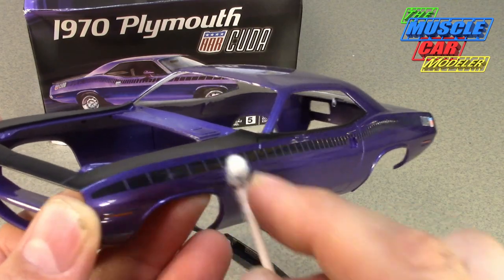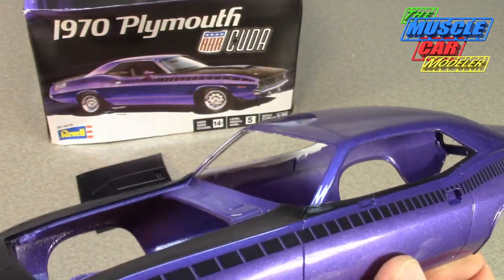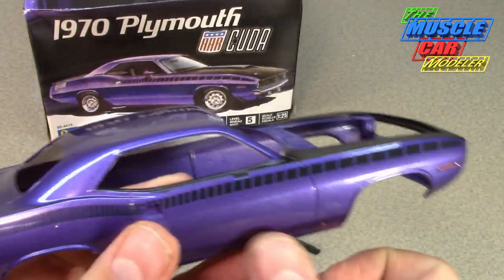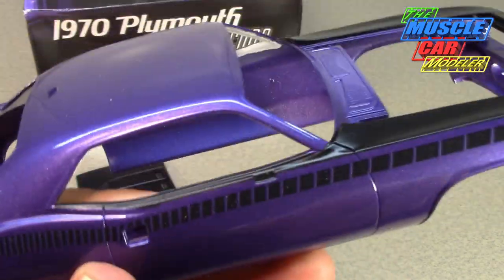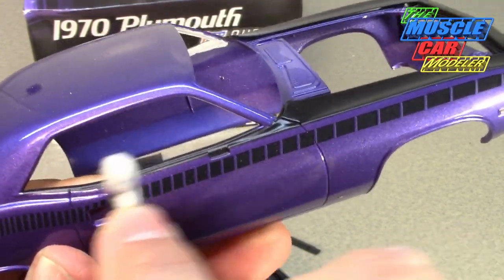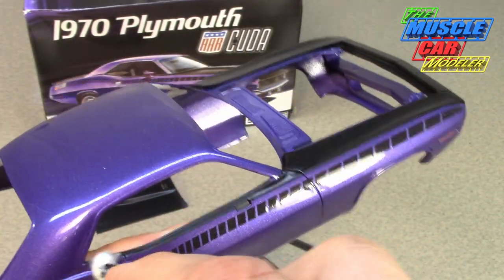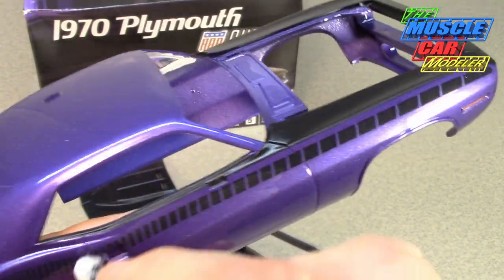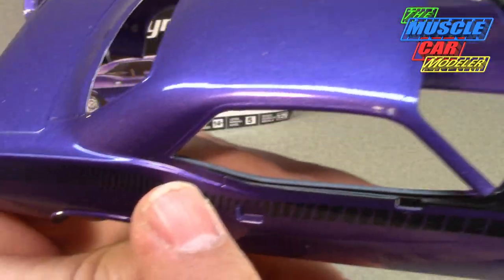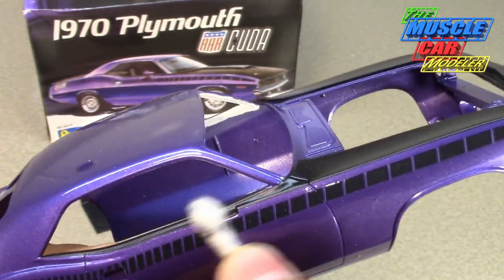Try to keep this on the side this way and don't go over the other way. I'm giving it some medium pressure — I do need it to polish. You can switch out your Q-tip a few times. I like the way that's coming out, and now it's time to do the other side. You can see where the overspray is right there. Using the real automotive clear, because it's a pretty hard, durable finish, kind of makes this step easier — one of the benefits to using it. I slipped up to the top side but at a real thin spot you can still polish it, or touch it up with some brush paint.